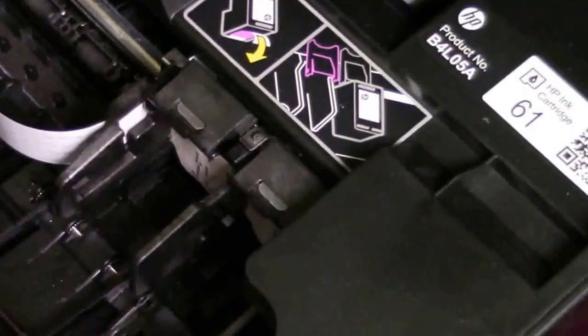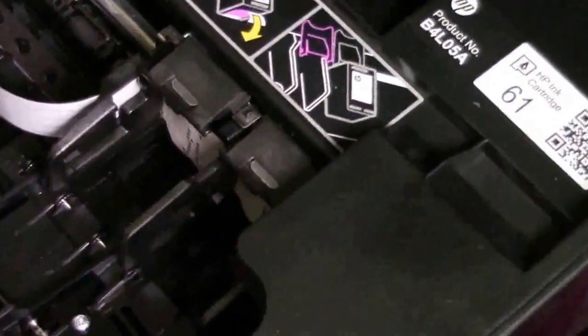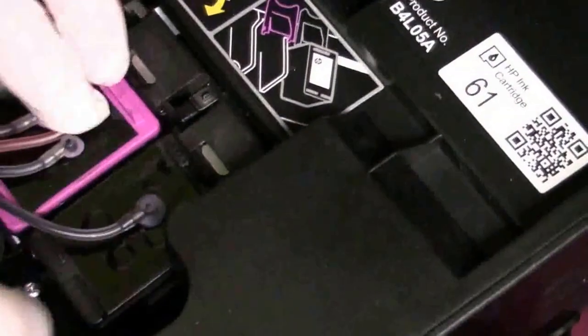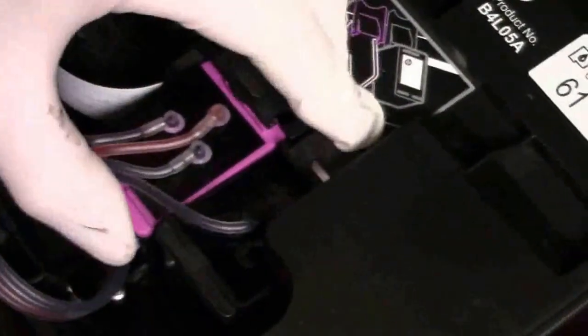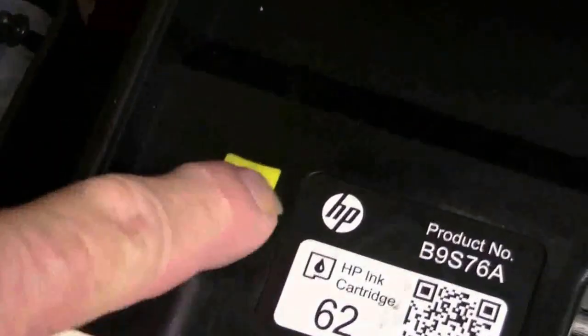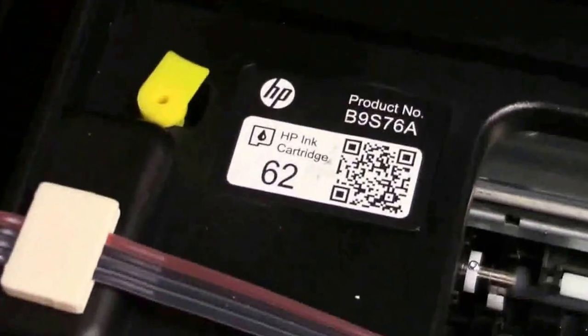When installing the cartridges and doing hose travel, make sure you have unplugged the printer — not just turned it off. Let the cartridges come over, then unplug it; that applies to any model. This lets you slide them back and forth without damaging the printer, then you can plug it back in. It just snaps right in. Then put your main hose bracket and any other hose bracket on. Some models require an interlock plug because the lid cannot close all the way — check your supplied instructions to see if it's required.